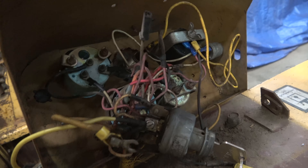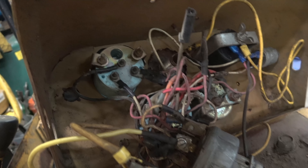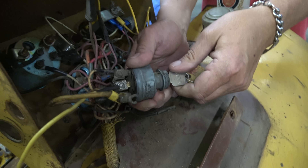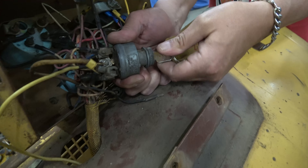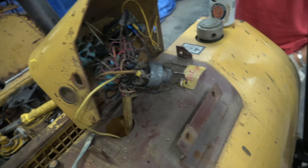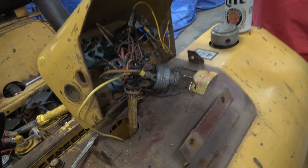I think we're just losing too much voltage by the time it gets to that starter solenoid. I want to clean all this up, but I just don't have the time right now, so I'm going to put it back together. I'd actually like to put a tachometer on this and get all the gauge lighting working. But for now we just ran a wire direct from the starter switch to its starter. So it's working. I might be able to take that switch apart and clean it up, but for now we're going to screw it back together and this is what we got.